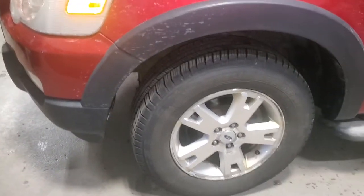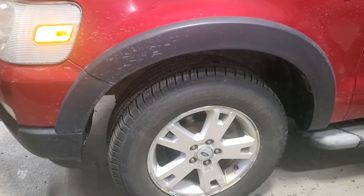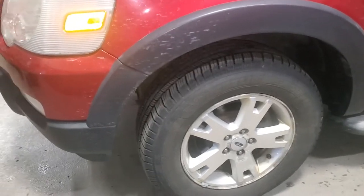The chronic ball joint squeak that people always confuse with a bushing or something like that — it's not, it's a ball joint. I mean, it could be a bushing, but most of the time it's the ball joint.